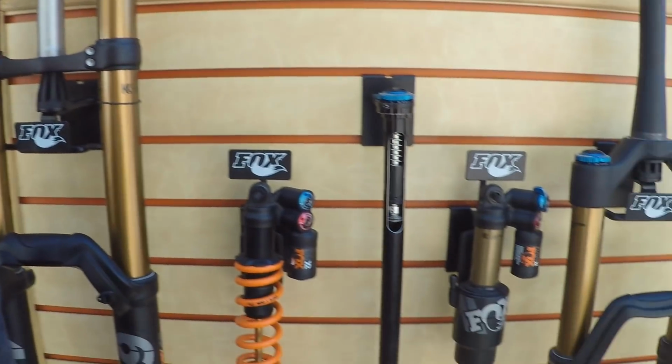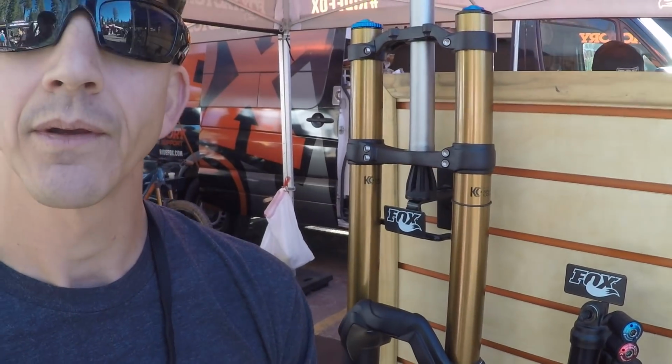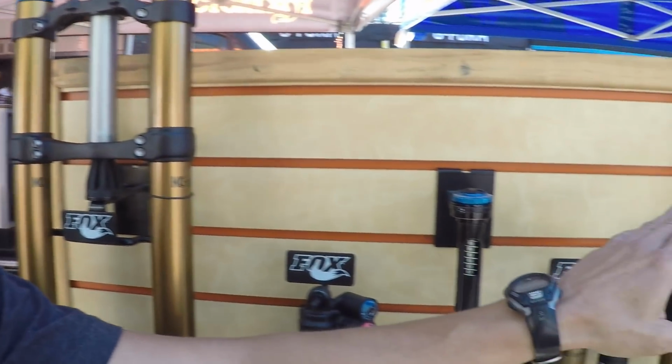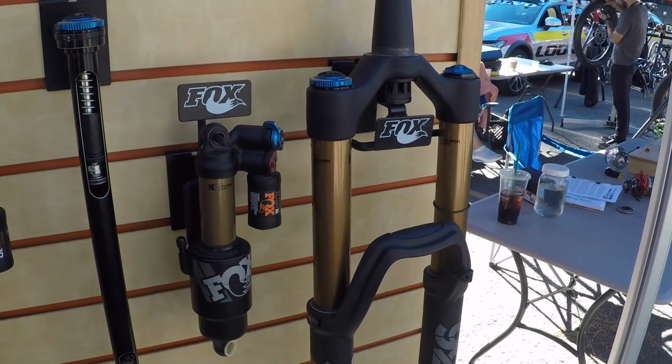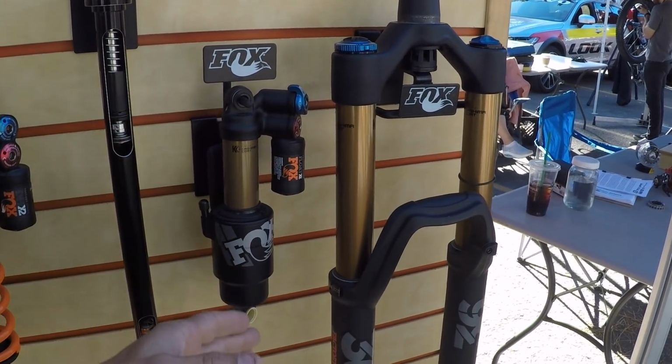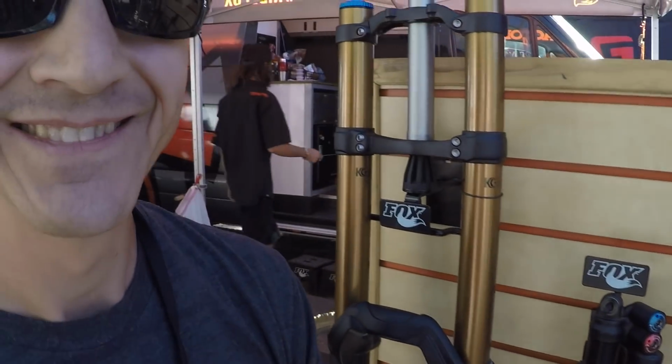Yeah. So, it's a little more durable for those bikes, a little better handling. Some of the guys that are out there looking to lighten up the e-bike as much as possible, they'd just rather run a standard fork. And we do have some e-bike specific tunes. That's what I was wondering. Okay, because there's factory. What does that mean? Is that your highest end forks? Yeah, so factory would be like this fork, where it's all the bells and whistles, lots of adjustment, Kashima upper tube, so maximum durability on the upper tube and the smoothest coating possible.